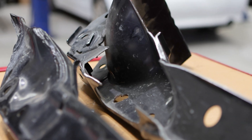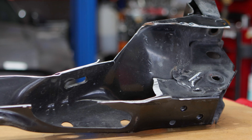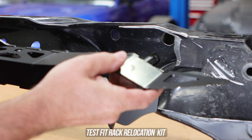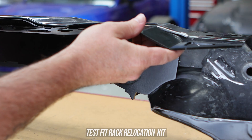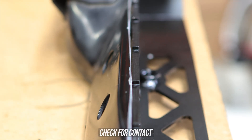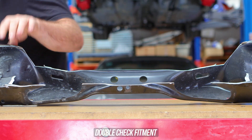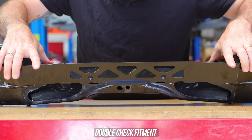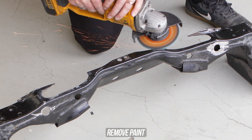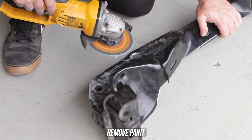While you have the grinder handy, make sure to smooth off all those sharp edges and paint so that the welds can bite properly. This includes those front tubes we hole-sawed earlier, just to make sure they're ground flat. Now go ahead and grab your rack relocation piece and test it in place, lining up the tube with the hole. Whilst fitting this up, make sure the rack relocation piece sits butted up against the subframe. If it makes contact, mark exactly what is making contact, then trim slowly until the top and bottom piece fit nice and snug together. This may be tedious as all subframes have a tolerance, but it is well worth it — welding is permanent, not like that tattoo on your lower back. Once that's done, remove the paint on the areas you plan on welding to the subframe for maximum penetration.